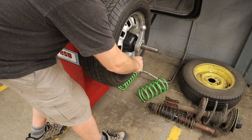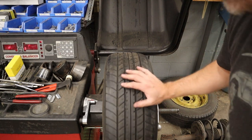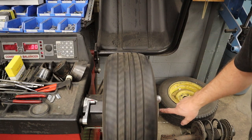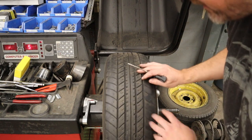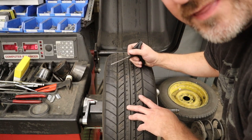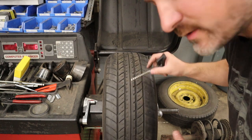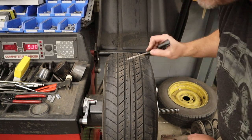On the last tighten I like to give it a little shake to help make sure it's centered. Once it's on, I always give it a little spin and look to see if it's wobbling — if you see wheel hop, that probably means you have the wrong cone or something's not sitting right. Another thing I like to do before getting started is give it a spin and look for any rocks in the tread. Pop them out with a tool so they don't affect the wheel balance when they fall off later. Also a good time to look for nail holes — if you're switching summer to winter tires this is when you could find and fix a nail.